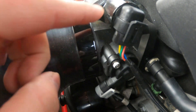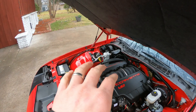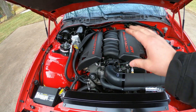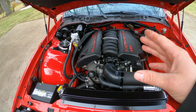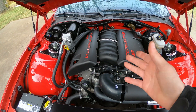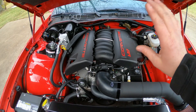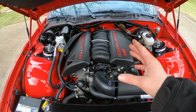Also, if you're running a cheap 40 or 50 dollar eBay throttle body, do yourself a favor and throw it away. Those things are not up to the quality needed to run your system correctly — cheap throttle bodies are cheap for a reason. I went with the Fitech throttle body and what a difference it made. I had a cheap China one on there and my IAC steps would not stay set properly, everything was bouncing around and it was really throwing off the rest of my tune. Do yourself a favor and get a good quality throttle body.